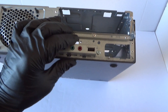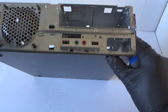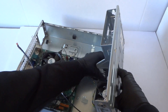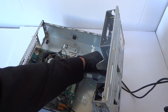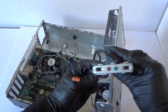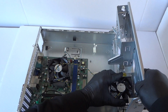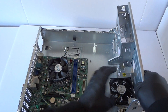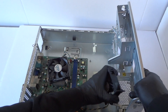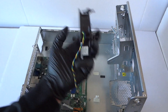These have one screw here that holds the USB for the front — it comes right out. It holds by one screw and it slides out. Now the fan here doesn't have any screws — it just looks like it holds by the rubber here, so just push like this and it should come right out. The fan is removed — this is an 80 millimeter fan.